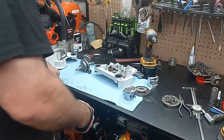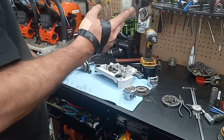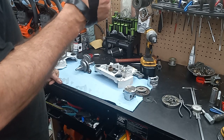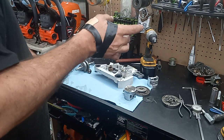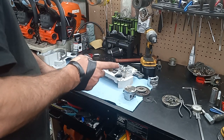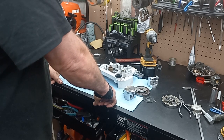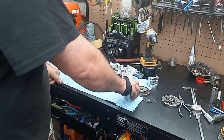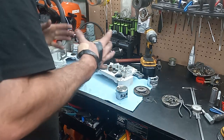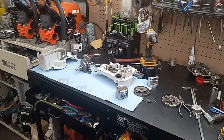And I know one person, two people that have stroker 661s, and I think I've seen 3 or 4 videos of them, so I know that can be done, but I've never seen anybody destroke a 660. And I used to destroke racing engines, so why not go big bore, little stroke on something like this and see what happens.